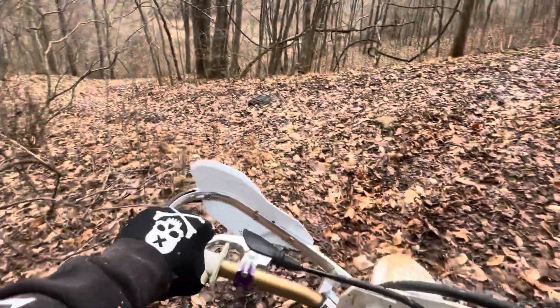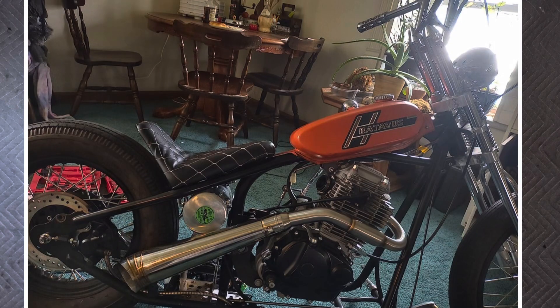You can get parts for it, you just got to know where to get them and it's going to take a little bit longer. What I recommend is when you get a little extra cash, go ahead and get a different set of clutches — the ones in it work pretty good, but eventually they're going to burn out. I can give you links to that stuff. Stay on top of those valve adjustments. And honestly, when you get a little extra cash, I'd go ahead and get spare rings, pistons, and stuff while you can, because every day they're evolving and always making something else. Right now this engine is a big thing and everybody's getting one to do motor swaps. People have even put them on street bikes.